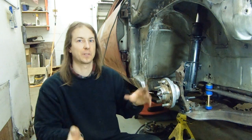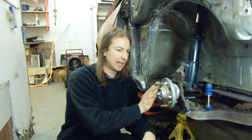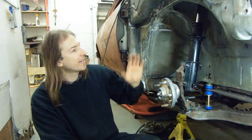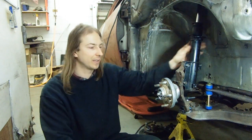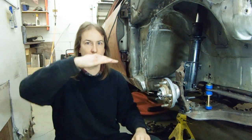Obviously springs are an issue, but since I'm using air suspension that will come in a later episode. The camber of the front wheels is still just a little bit positive, but again, until I get the car at ride height there's no point playing around with that — I may just have to move the top of the shock tower in a little bit.